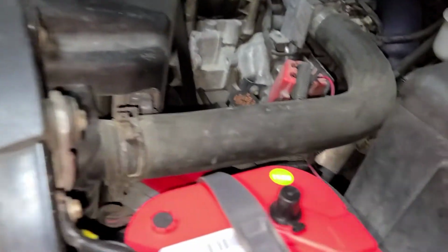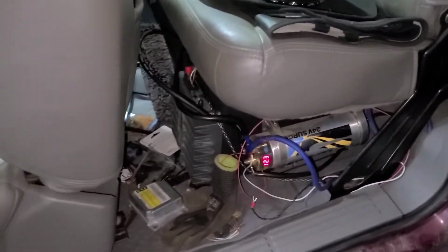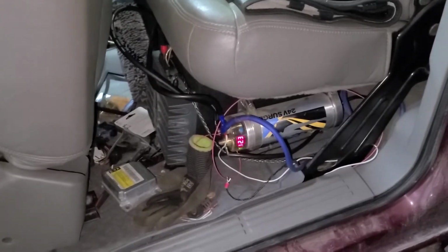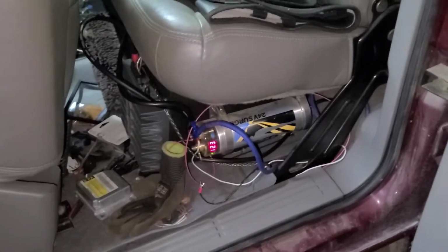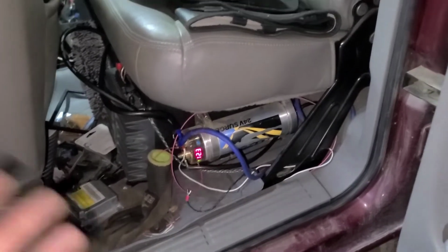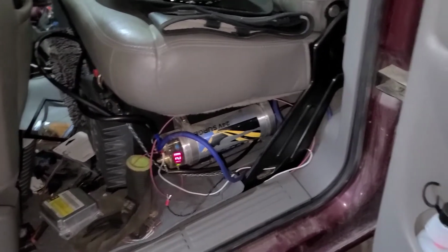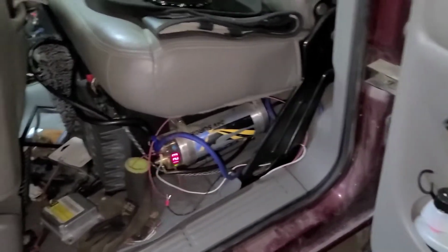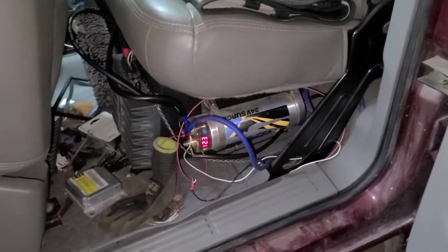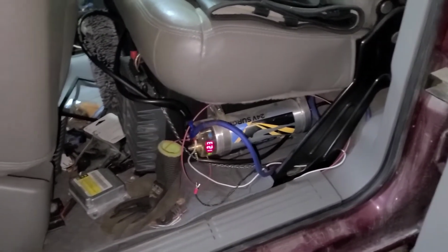But I came out this morning and went to start the truck, and it had 11.8 volts listed there. Well, that's not all that great. That's after running the truck, and I get out and pretty much look at it every time. It'll say 12.2 volts, or 12.3, but as soon as you shut the truck off, obviously the battery's going to go down, but it should stay above 12 volts. I'm pretty damn sure it's supposed to stay above 12 volts.